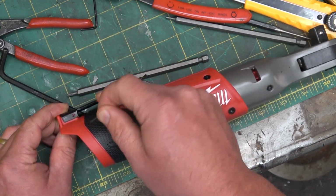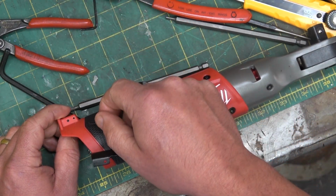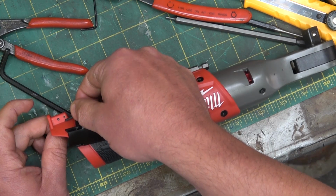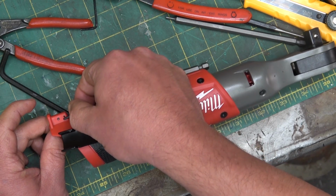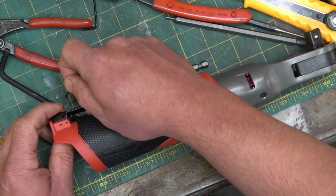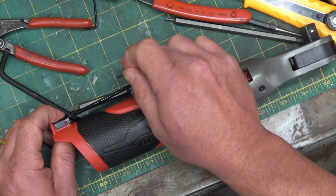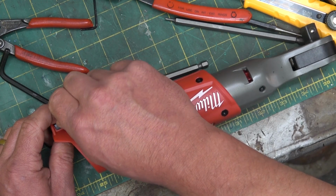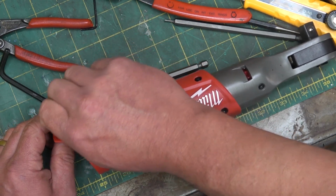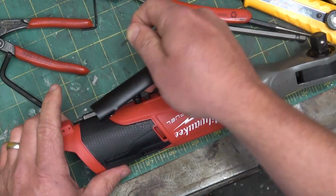However, this little pin on this paddle switch, you see how much meat there is? Yeah. So on their grinder, same thing happened. Busted this guy off, clean out of the housing. So that is what's going to happen. That's a definite weak point for this guy. You get a big skookum paddle on this little itty bitty pin, it's going to break that housing, and it'll be flopping in the breeze, and then you'll just be running it like this, and then that'll break.